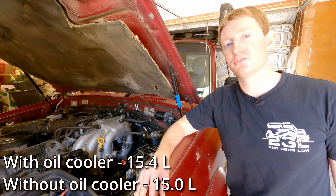Now we're ready to fill up the ATF, and the way we do that is through the dipstick hole. Take out the dipstick, wipe it off, and put it to the side. Grab your funnel with the thin end — as long as it's less than about half inch or 12mm it'll fit into the dipstick hole. I find it works well to add a second slightly larger-mouthed funnel to give you more room to pour into. Then grab the first of your 4-litre cans and add that in. Don't pour too quickly — it's a small opening and if you pour too fast it'll flow back up out of the funnel. Pour with the oil can on its side to prevent glugging and get a nice smooth flow.